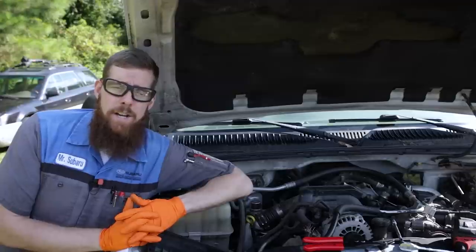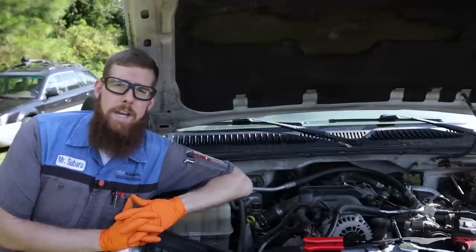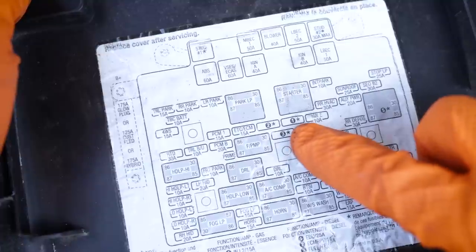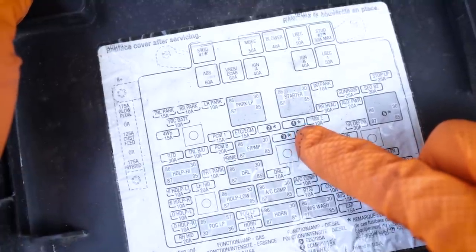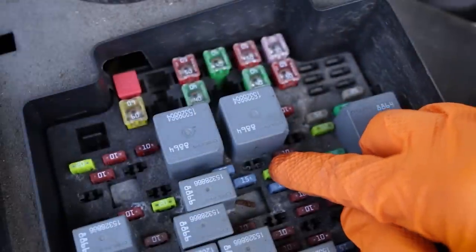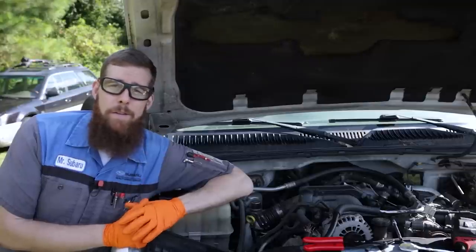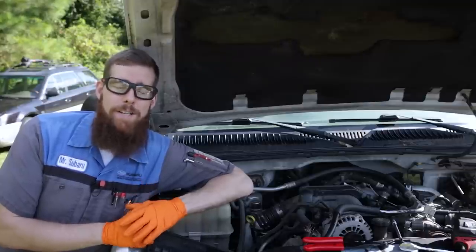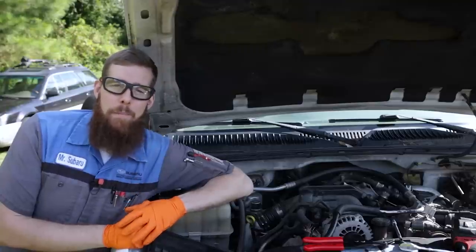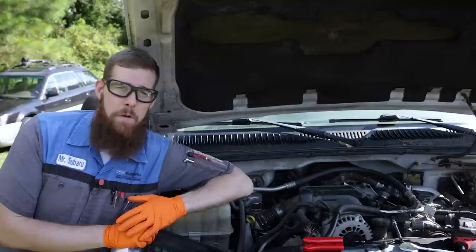After a little bit of head scratching and looking in the fuse box, I found that I had a blown fuse for the EDU as labeled in the fuse box, which would basically be for the fuel injection control module, or the FICM. I replaced that fuse hoping it was just a fluke, but rarely is it a fluke when a fuse blows. Started the truck up, it ran for two seconds and then keeled over again, blowing the same fuse.